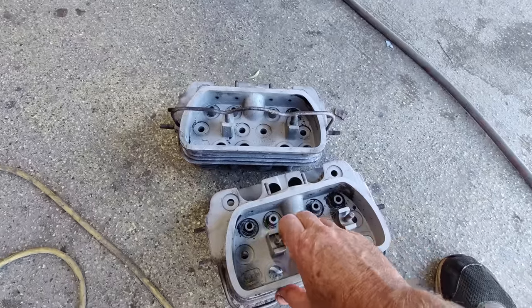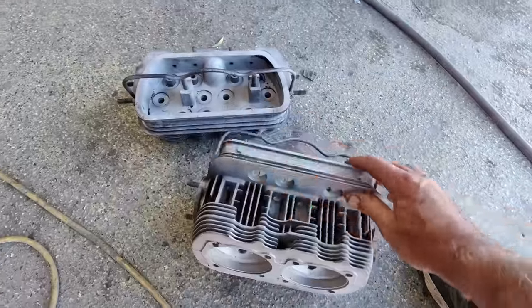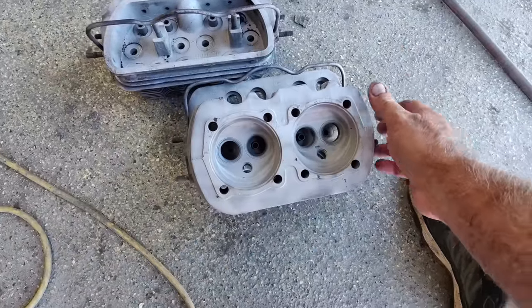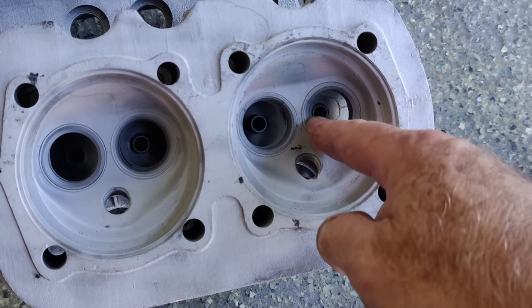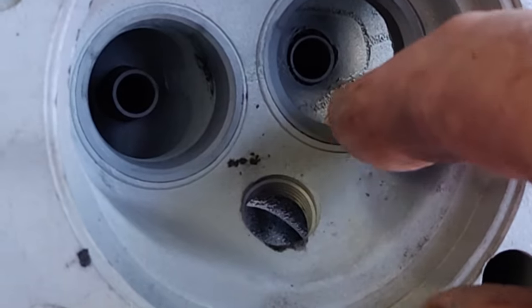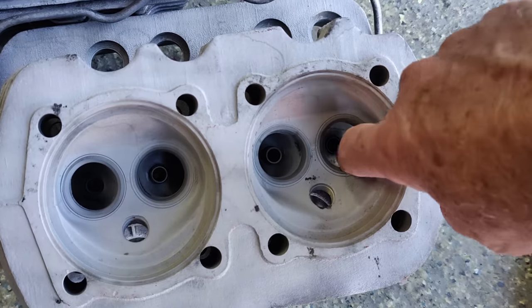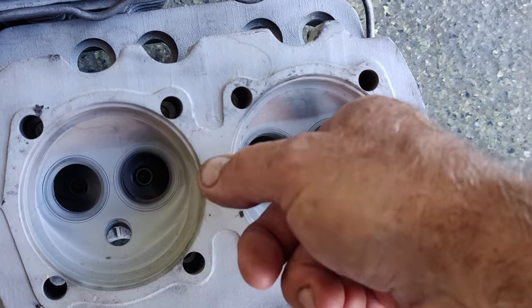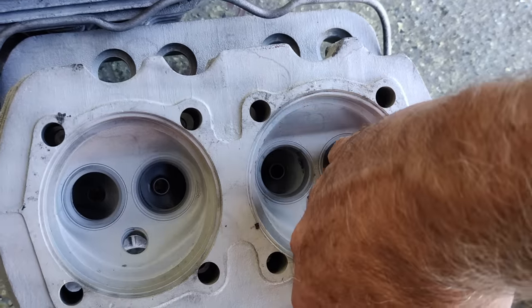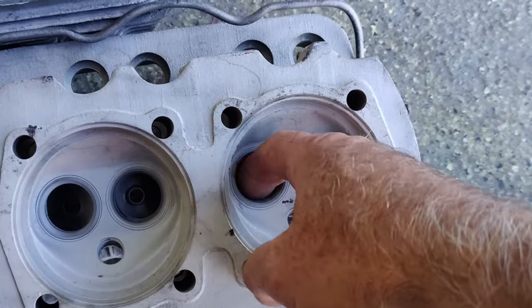All right, so if you look at these 36 horsepower heads, I got them all sandblasted. Saw some of that, maybe. But if you look here in the exhaust ports, the seats are pretty worn, so definitely by the time I grind those, they'll be quite a bit further down, but that's okay. If you look here, and you can get your bigger finger in there on the 40 horse and the 30, and on the single port heads, you can't even get your finger in there at all. So these ones here, I don't think there's really much you could do to port them.